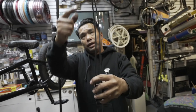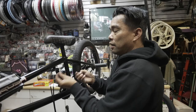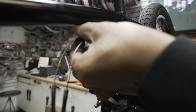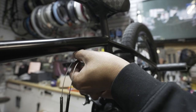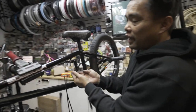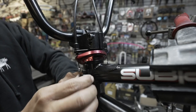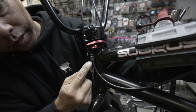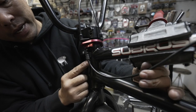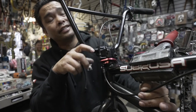I like to run the dual because what it does is it controls each arm individually. This dual mount here goes behind the post. What's the difference if this thing goes behind that mount or in the front? I say it doesn't matter — I'm just using the rear because it looks a little bit cleaner. I don't tighten everything down until I've got everything fully mounted, and then I can adjust. Look how clean this loop is. Some guys run this thing super tight — well, when you run it really tight, that's just more friction and a harder radius that when you pull, it's not going to be smooth.